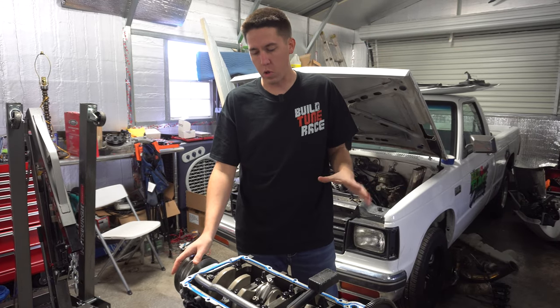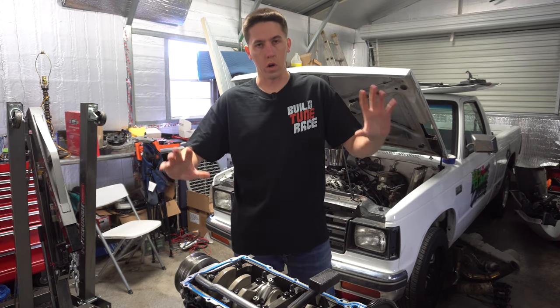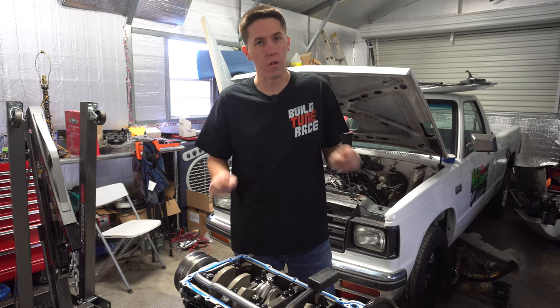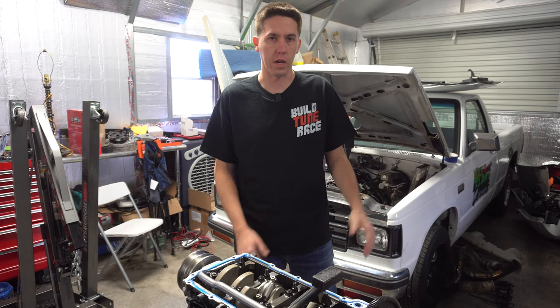But today we are pulling apart the engine finish. We know that there's a hole in the piston. We looked in there from when we got the pan off the other day. We're going to roll it over today, get the heads off of this thing, and look down in there. And hopefully it did not get into the cylinder wall. If it got in the cylinder wall and the block might need some repair, then you might need to find a different direction.